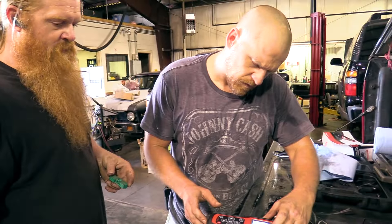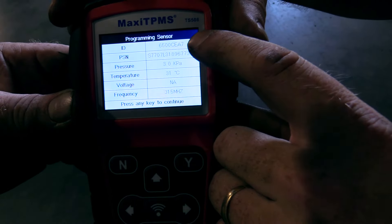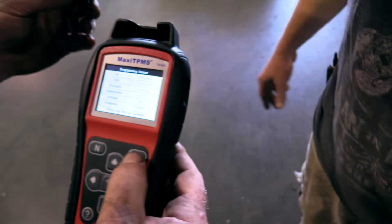So we're taking the info from that sensor and putting it on this sensor. Oh, that's awesome! I don't even have to program which wheel it's going on — that's freaking sweet. Now you can auto-create. On the GM you can just auto-create. If you had a bunch of dead ones, all you've got to do is that lock-unlock thing. And that should be the same. It took that number from the old sensor — get a shot of this number, Caleb.